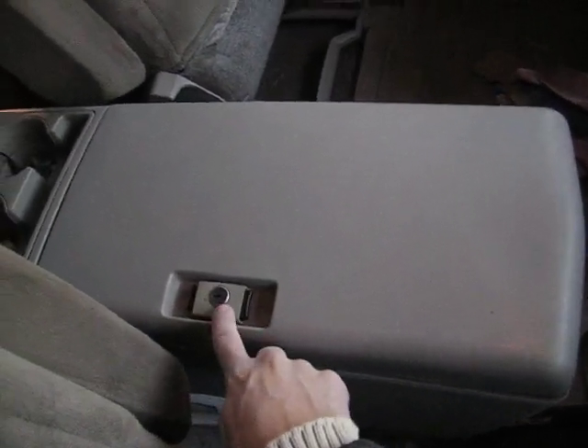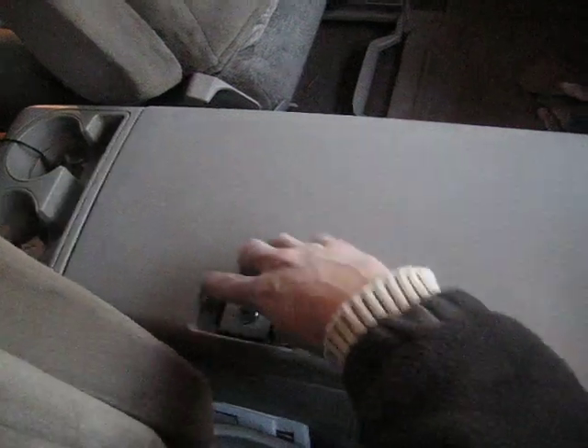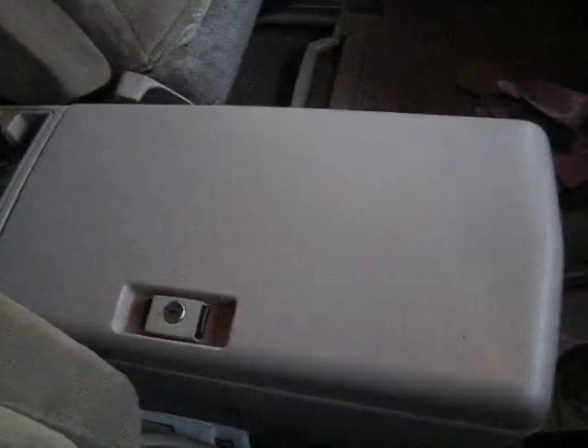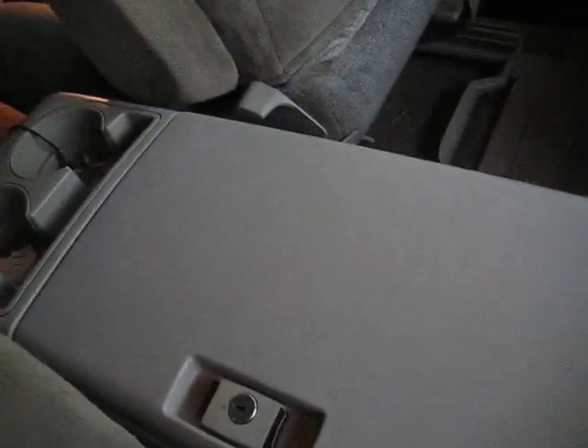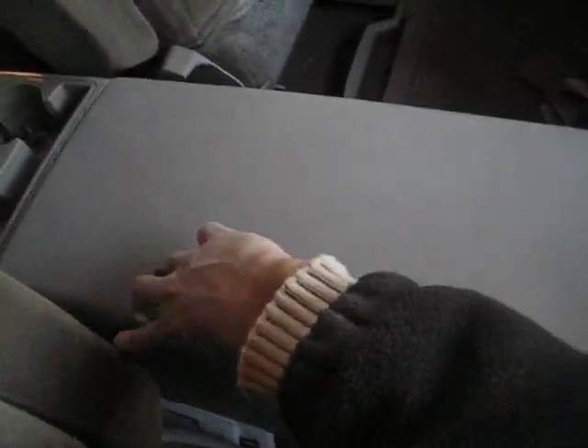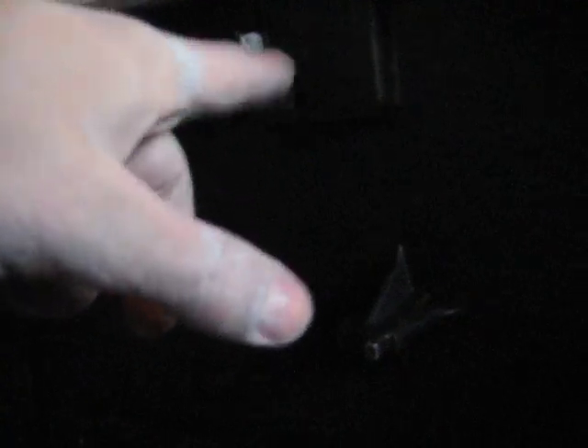If your key is locked and you just can't open it, you can remove the tray in the back. With your hand and a pair of pliers, you can get all the way to the lock and get some kind of screwdriver to pull this clip here. Once you've got this out, you can slide these — they're spring-loaded — right out of the lock here.